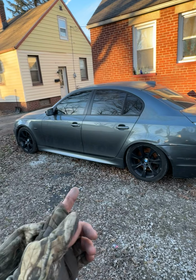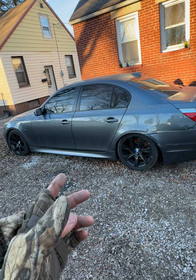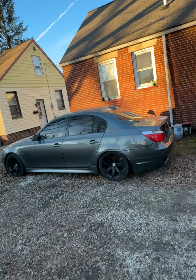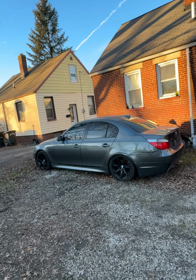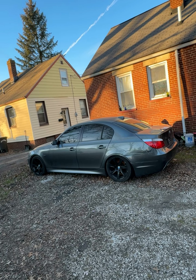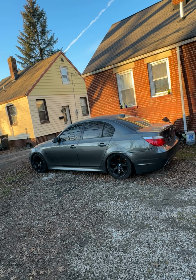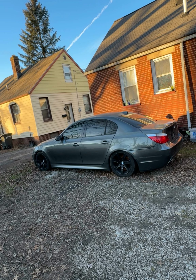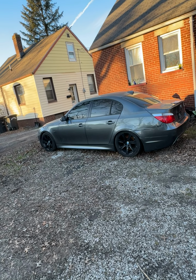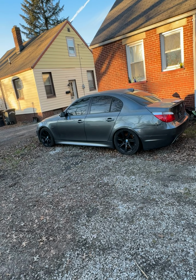If anybody knows anything about the E60 550i with active steering and all that, I think that thing purrs like a kitten too. I got that for $1,200, and was driving it the same day. Pretty much exactly the way it sits. I bought that for $1,200 because it had an overheating issue. And it ended up being the fan. The fuse for the fan was blown and the radiator was packed full of debris. Cleaned that out. I really could have swapped the fuse, but I ended up doing a whole fan before I realized it was the fuse. And it would have been good to go. It's been good ever since.